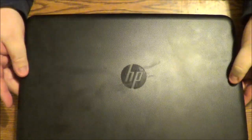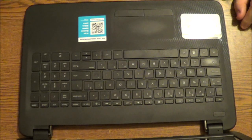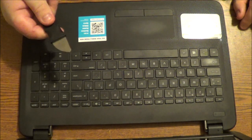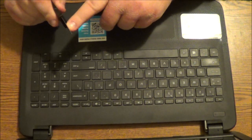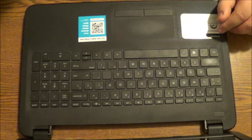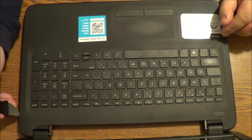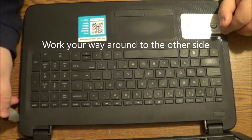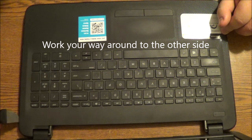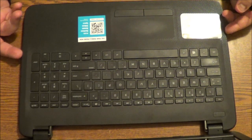Now you want to go ahead and flip it around and lift the top cover. The next step you want to do is get your plastic pick opener or a plastic card — anything that's real thin that you can use that will do the trick. What you need to do is go around the sides here, and you'll see right here there's a little seam where the top and the bottom connects. Gently slide in the pick, push it down, and you'll feel it pop out. Once you have it separated, go ahead and close the lid and flip it back upside down.